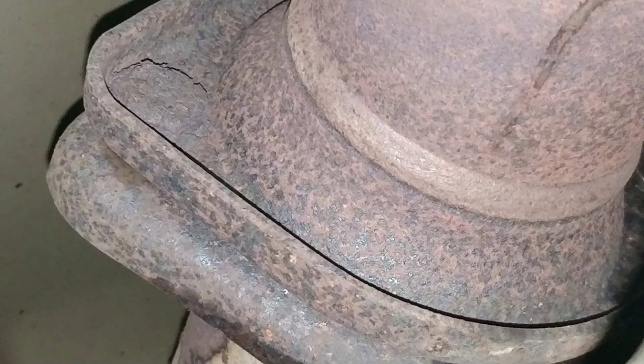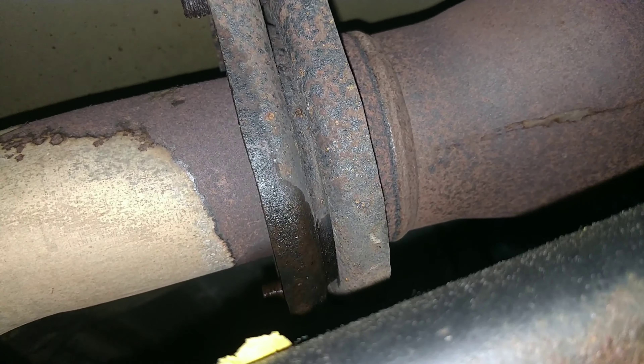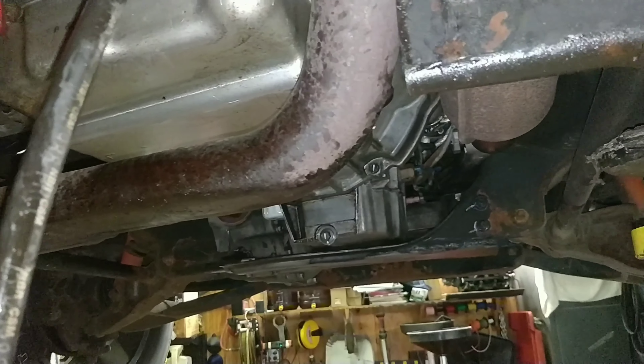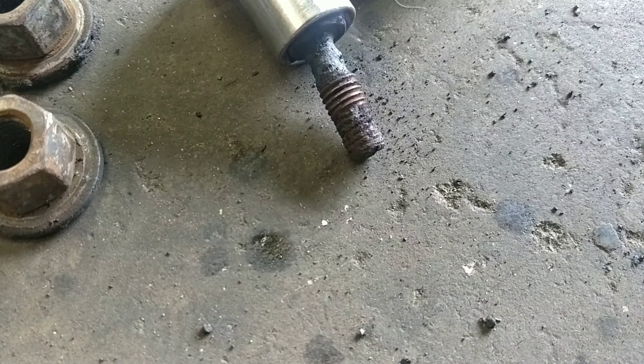Hopefully I can slide the trans back without moving the exhaust, or maybe I can move the whole exhaust back. These bolts look fine - I had oiled them earlier. Those look fine to take off, but the one back here doesn't look like it's coming off too easily. I'd probably have to drill it out or pound out the stud, whichever way it comes out.